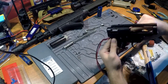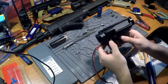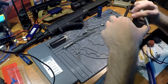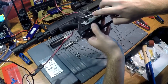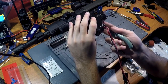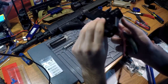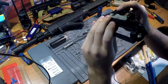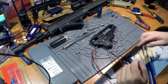The gears are spinning but they are definitely tighter than they should be, which tells me the new bushings are thicker than the previous ones. I want to find out which gear is really stuck. I'm going to take my needle nose pliers and test the bottom of the gear axles for play — poke upwards to see if there's any movement. There's a lot of play in the bevel. The spur does not have any play at all — pretty tight. The sector gear also does not have any play. So the two gears with new bushings are tight, and the bevel is loose — we're going to do a swap.